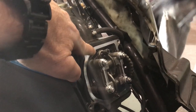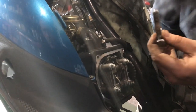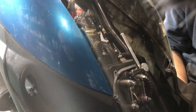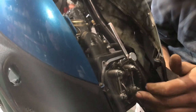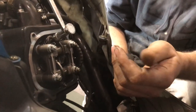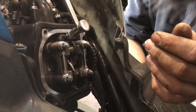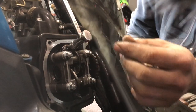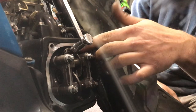The top one is the intake and the bottom is the exhaust. We have a valve tool here. The spec we're adjusting to is 0.004 inches for the intake and 0.005 inches for the exhaust. You can do it freehand, but if you have a feeler gauge you want it to feel slightly snug between the valve and the adjuster.